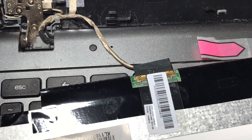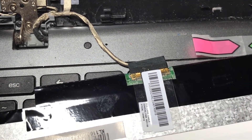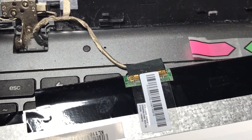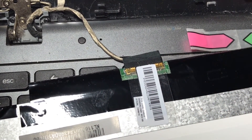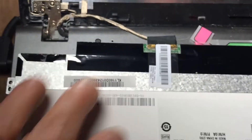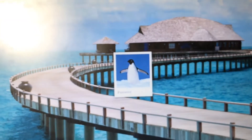Indeed, when I opened up the bezel — there are videos of that, I'll link it in the description — this cable, which is retained by a piece of tape, like cello tape, was just cocked in the connector. I'm going to take that tape off and replace it with stronger tape after I tighten the connection. I pressed the connection back in, started the Chromebook back up, and it works fine.